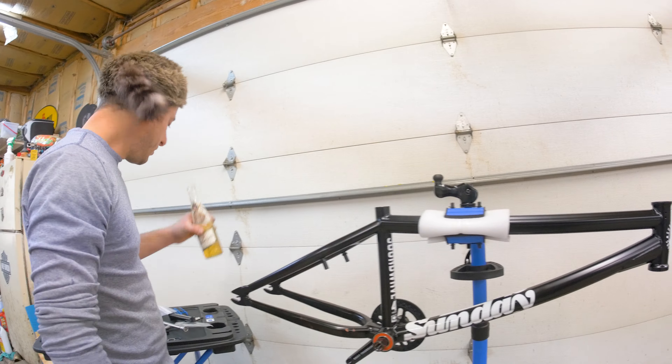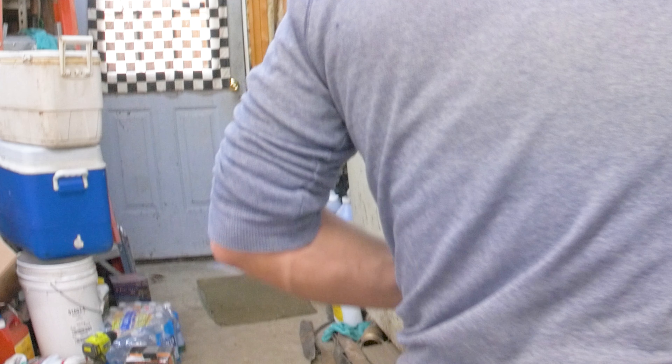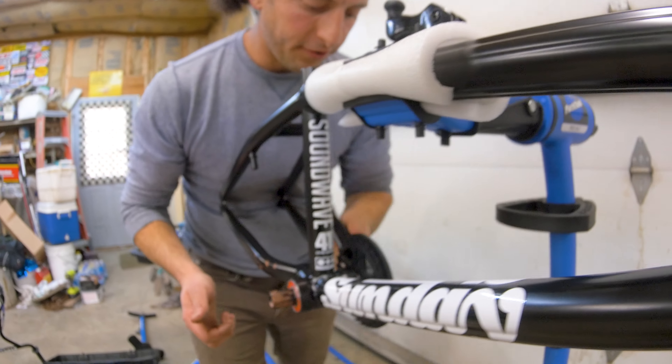And then you put the wedges on there with the thick side on the inside, so flip it around. You don't have your cone spacer. I don't think you need that spacer in your sprocket at all. Does that go in there like that or the other way? The other side, I think. The spindle gets bigger where the sprocket goes on those cranks between the crank and the sprocket — see how there's a gap? That's it. Oh, I just saw a mouse. I think that's the spacer — I think it's built into the cranks. Oh, that would be why it was lopsided too. My fault we're taking it apart again.